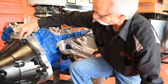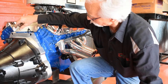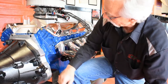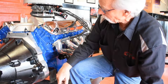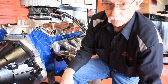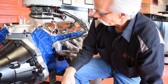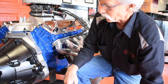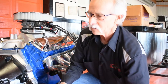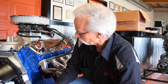I didn't design this — Ford just likes really long bolt bosses, so that's just the way it is. Other than that, the depth of this adapter plate hasn't really shown to be a big problem, except when putting it into a Thunderbolt or some older Mustang. No matter what you do, you're going to have challenges — Ford even had problems with those. To put these into Mustangs, they took the shock towers out and did all kinds of things to make it fit.